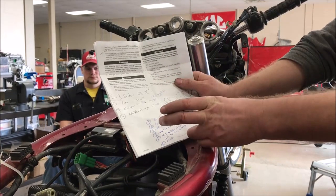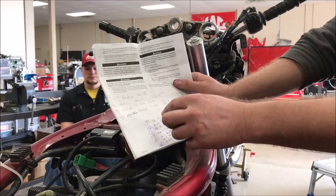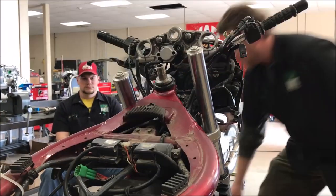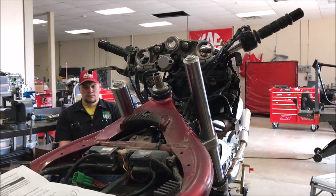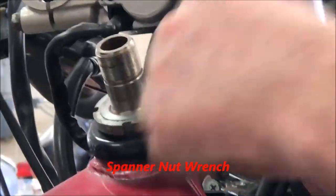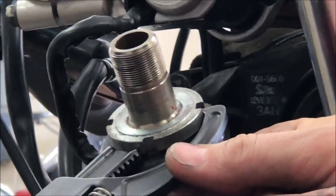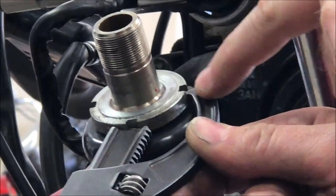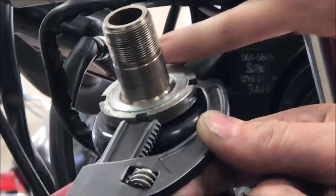The other thing you're going to see is we might have to repeat this process. When Suzuki or anybody tells you to use this procedure, it's just to get it to a point where you actually check the work. The first step is to torque to 32.5. This is a special tool for the top bearing — you can see where it hooks in. I want a real 90 degrees from the spanner nut to the spanner wrench.